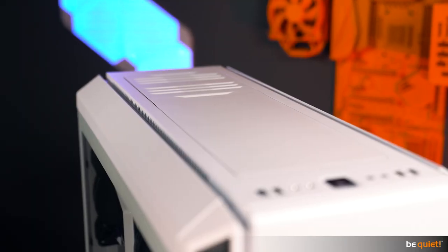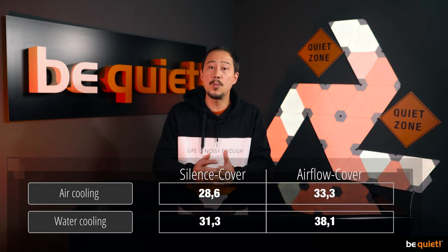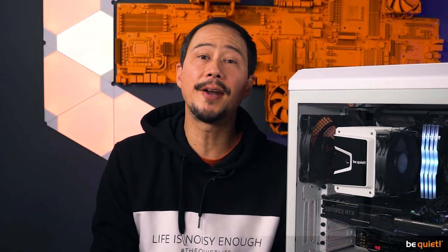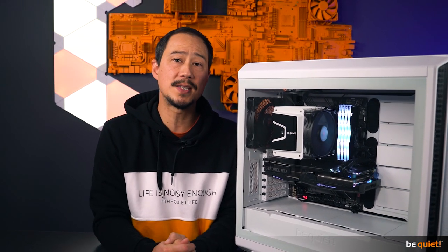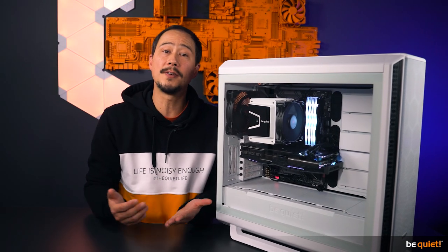But does that mean everyone should automatically use water cooling and airflow covers? Not at all, because this performance comes at a price: the noise. Regardless of whether you choose water or air cooling, you always have the choice of performance or silence using the closed covers. In a comparable testing setup in the noise chamber, we registered a drop of 4.7 decibels with air cooling and even 6.8 decibels with the water cooling system when compared to the open mesh covers. It is up to the user to choose the best setup and configure their fans so that the optimal balance of cooling performance and noise level is achieved. A water cooling system with a mesh front will rarely run at 70% fan speed — an increase of just a few degrees will save you a lot of decibels. The air cooler, on the other hand, could spin a few paces faster before reaching louder regions, which offers the opposite potential.